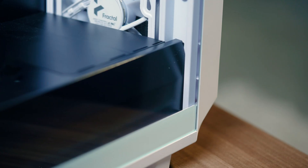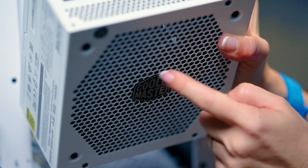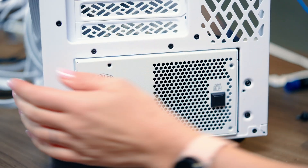It's time to do this. First, open up the main side of your case — every case is different, but this should be relatively easy to figure out. Some people prefer to place the power supply first, while others prefer to install it after placing the motherboard. I usually prefer to install the PSU first because it can be difficult to do after other components are installed. Position it with the fan pointing downward, line up the screw holes with the holes on the back of the case, screw it into place, and lay any cables over the case so they are out of the way.